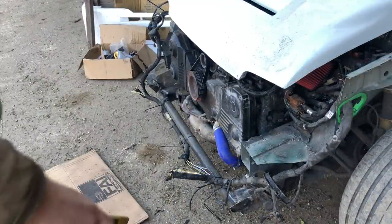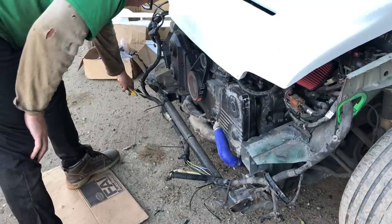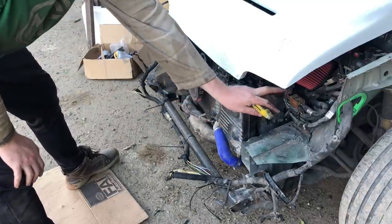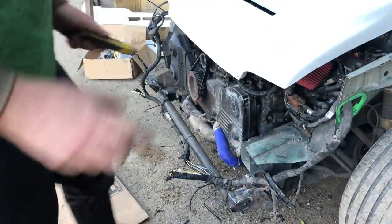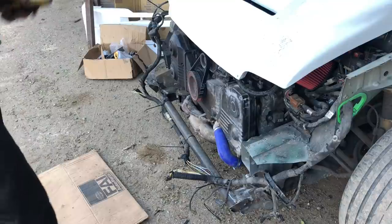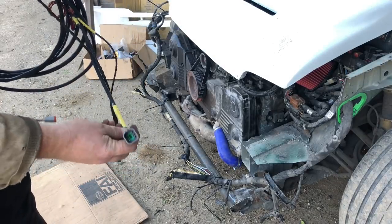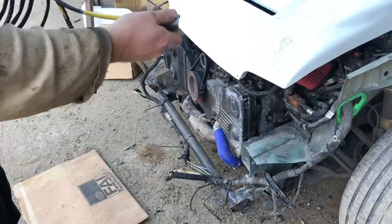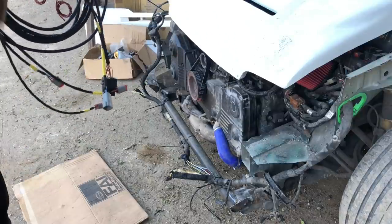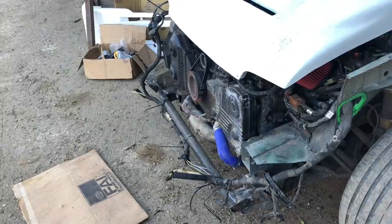We're in luck - the grounds go off either side, that's not a problem. The two-speed fans both come up this side mostly to the fuse box. We've got four different wire colors, so we can trace them back up to where the fuse box is, and that's where we create our new plug and join onto the wire that runs to the brand new loom supply. We've got a six-pin plug there which replicates those six wires. We'll wait for the proper crimping tool because if somebody sends me good stuff, I'm really not going to bodge it - I'm going to surprise them.